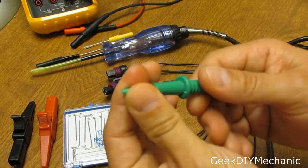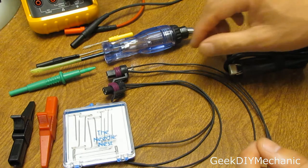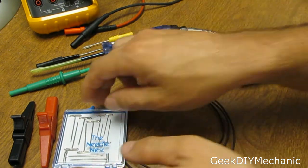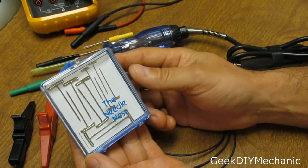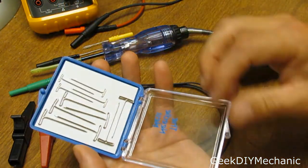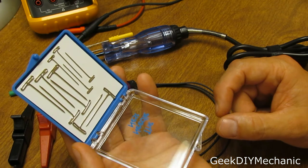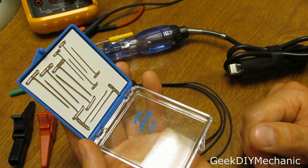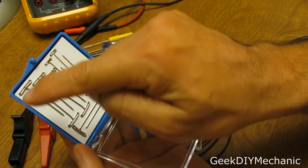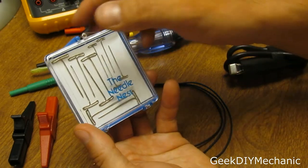Here are two alligator test probes and the two connectors we're going to work on. And T-pins — I use these frequently. They're very inexpensive. I found this holder at a sewing store and it's magnetic, so it holds the pins in place. That way I know I don't leave a T-pin in a connector in the car, because as they drive it might hit ground or whatever and cause a short, which is not good. I use this for keeping inventory.